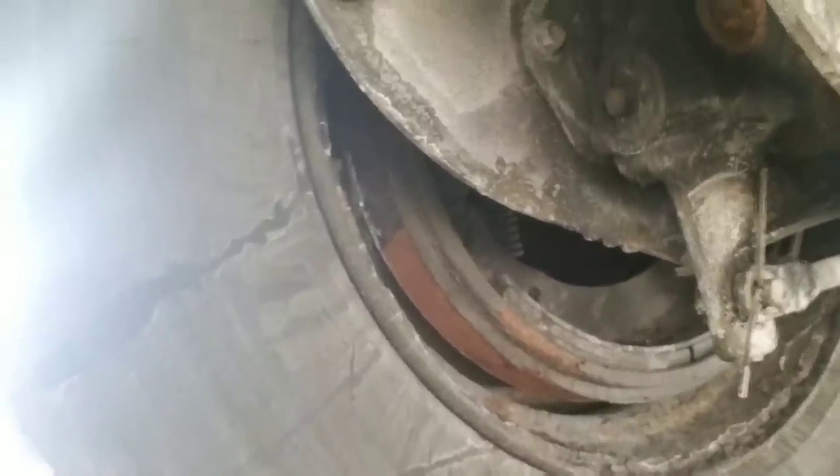When I drained the tanks on the trailer, I didn't see any air. I also don't see any air in the backs. So I'm going to check and see if there's any air coming through the airlines.